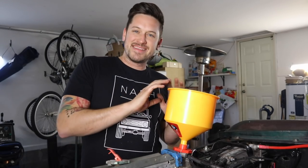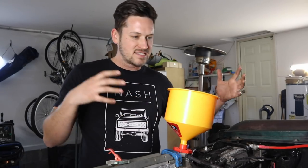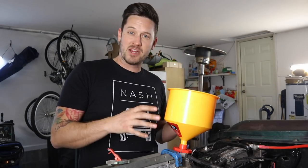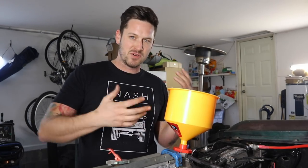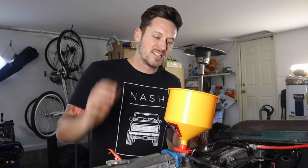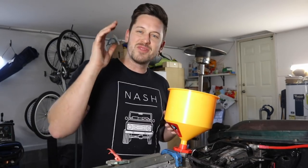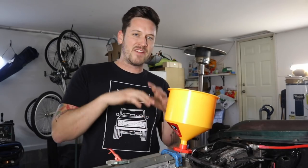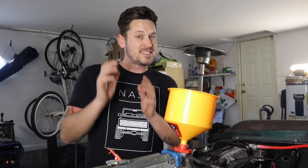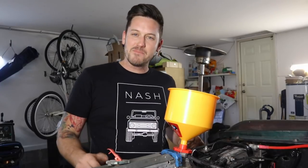This thing is great — they are super cheap to buy and it really helps. If you're having overheating problems, you need to try burping your system because you may have air bubbles in your engine, radiator, and heater core, and this is a great way to get rid of those bubbles. If you found this video helpful, download the Better Bronco PDF — it's free and has about 20 things you should be looking at to get your Bronco running and driving better than it ever has. Pick yourself up a spill-free funnel too.